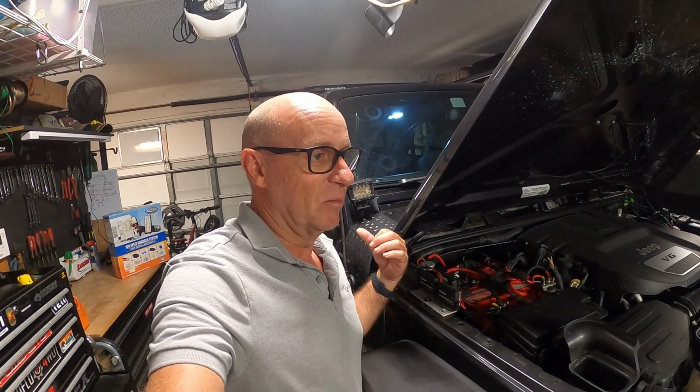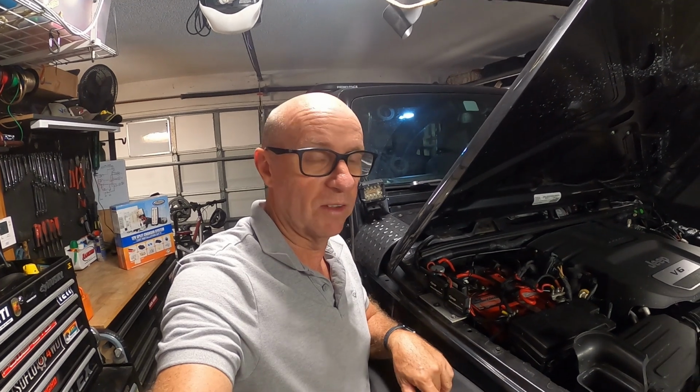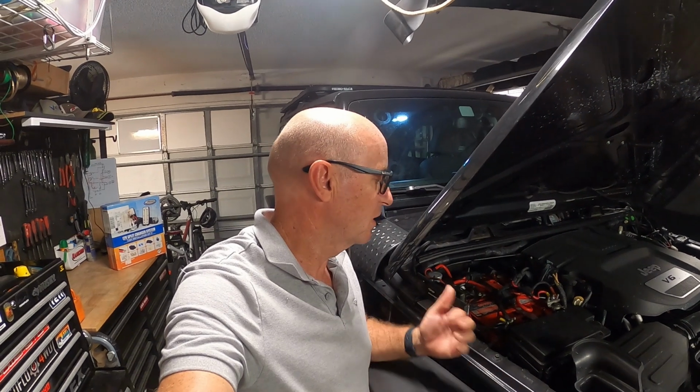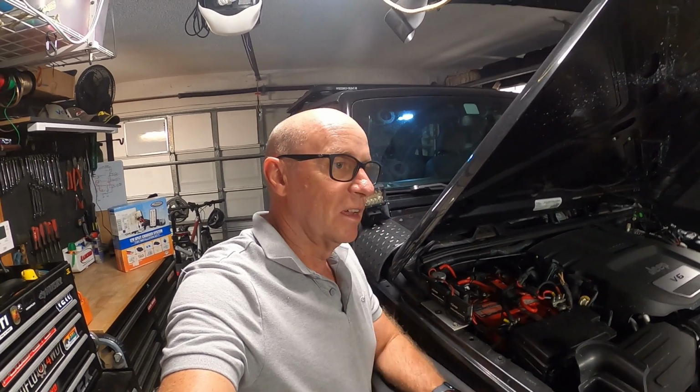So I usually don't run them on the wheels when I know I'm going to be airing up and airing down. But they're pretty handy to have on highway driving to monitor tire pressures and especially tire temperature, because you do have the factory pressure sensors in your wheels, but it doesn't give you any temperature. So I like to monitor temperatures on the tires as well.